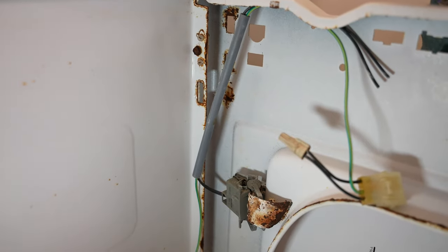Now plug the plug back in. This is the part where if you ordered the wrong lid switch it might not line up and won't go in. If that happens, you can either get the right switch, or a less recommended but possible workaround is to snip the old female connector off and wire-nut it to the new lid switch. Now let's put the control panel back on.